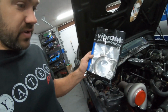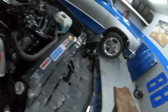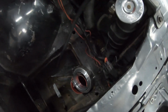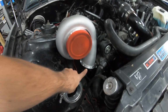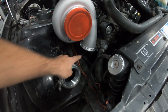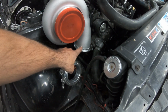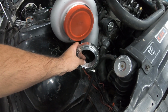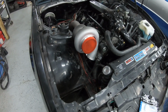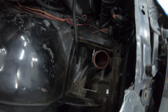So the 3-inch V-band that I bought is going to get welded on there. Whoop, see you later, nerd. I'm gonna cut this flange off and weld on a regular 3-inch V-band. I do believe that the inside diameter of this deal is 3-inch anyway, so it'll be fine. And we'll do that. Also, I had to open up this hole.